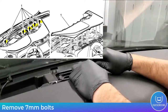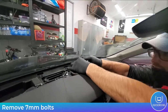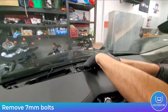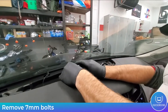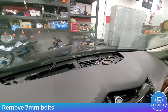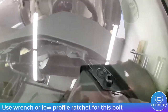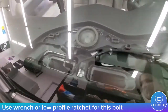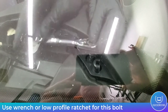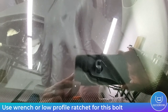With the dash grill removed, remove the five 7mm bolts holding that piece on — they're shown in the photo highlighted in yellow. It really helps to have a smaller low-profile ratchet with your 7mm socket because some clearance is tight near the windshield. The bolt in the corner by the A-pillar is the toughest to reach. A low-profile 7mm ratcheting wrench works well. Be careful to avoid dropping bolts into the dash or cracking the windshield — have patience on this one.